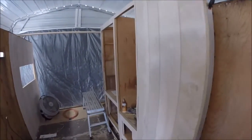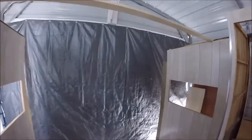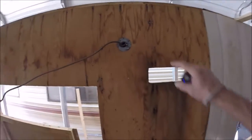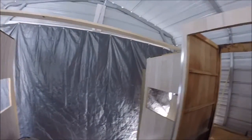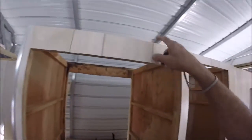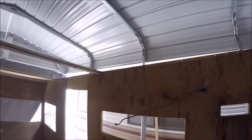There's no paneling that goes here on this plywood wall — it's just flush. That's how that works. The paneling doesn't start again until the end of the door here. After I get the wall sanded down and get the gimp on — the gimp goes right on top here all the way around — I can go ahead and put the first two top ceiling panels on here.